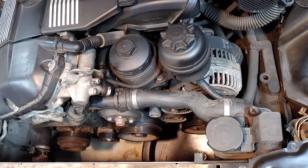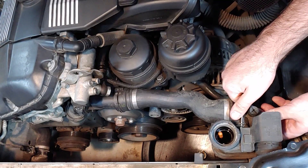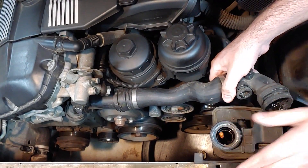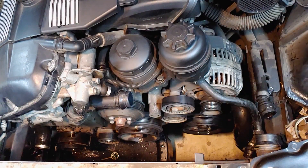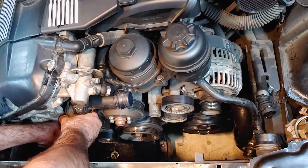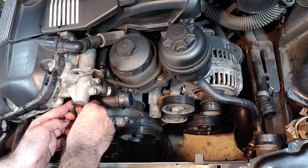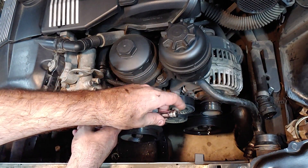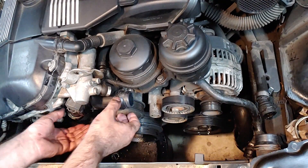Put your catch pan in place, remove the cap from the expansion tank, and use a tiny flathead screwdriver to lift the clips on the radiator hoses before disconnecting them from the thermostat. I removed the hoses completely to install new ones. Remove the electrical connection from the thermostat by depressing the metal wire and pulling it free. The thermostat housing is held on with one 13 millimeter bolt and three 10 millimeter bolts. With all four bolts removed, the thermostat should easily slide out.